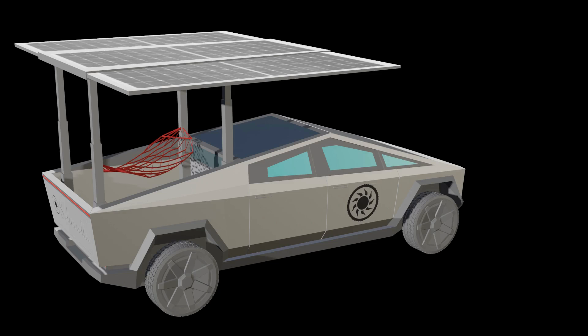Red Foo's build could go straight in because we had control over that vehicle. However, I don't think any manufacturers right now have a solar MPPT input, so we'll be pushing on that. In the meantime, we're doing what we have to do to get the power in — though we do lose some efficiency going through all those components, upwards of 25 to 30 percent. That would bring your 50 miles of range down to somewhere in the high 30s to 40s.